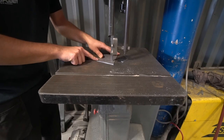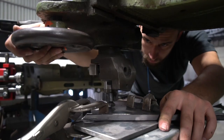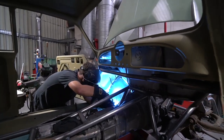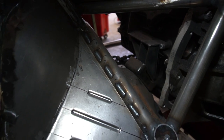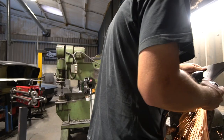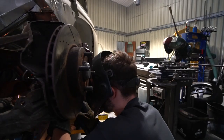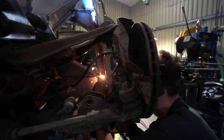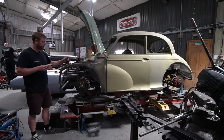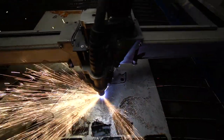So the Morris - more progress on this. Mostly what Scott's been working on was the sides of the bulkhead at the front, and he started on the footwell/inner wing area. There's a flat footwell panel he's made with beads rolled into it to stop it drumming. And there's a formed panel in this section which gives us the wheel clearance when it's on full bump and full lock. He's just started that on the other side. Moving forward we're going to be doing the seat mounts and an inner wing section. We've already done the damper mounts, cut on the top to have the curve profile we're intending to run along the inner wing panel.